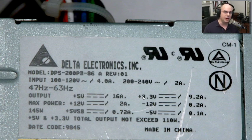Not all power supplies are alike in that configuration. This one has a maximum output of 145 watts, and the combined plus 5 volt and plus 3.3 volt output is not to exceed 110 watts. That gives you an idea of the capacity of this power supply, which you can compare to your motherboard and components to determine if you need a larger one or one that provides different amperage.